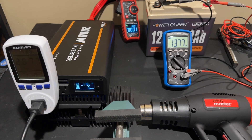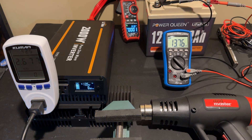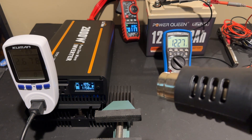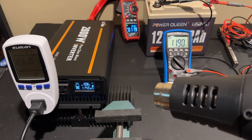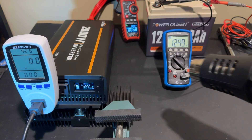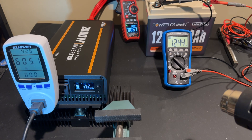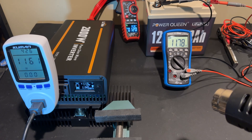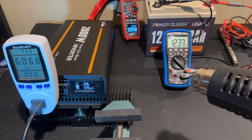We have the battery connected to our inverter with a clamp-on amp meter to read amperage out of the battery, and a meter connected to the battery terminal to see voltage — right now just over 13.7 volts. Kicking on the heat gun on high, we're pulling over 1,000 watts out of the inverter, which is about 118 amps out of the battery — way over the specified rating. I wouldn't recommend you do that. On low, the inverter puts out about 600 watts, with the kill-a-watt meter agreeing at around 605-606 watts. The battery drops to about 12.44 volts and we're getting 57 amps out. Remember, if people are testing batteries and they're not showing data like this, it's a show and tell, not a test.